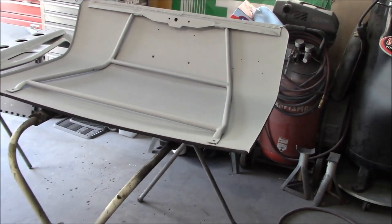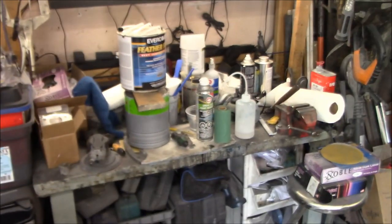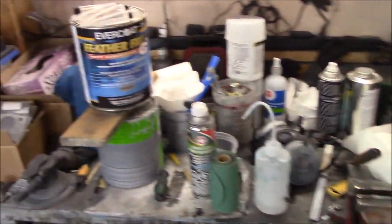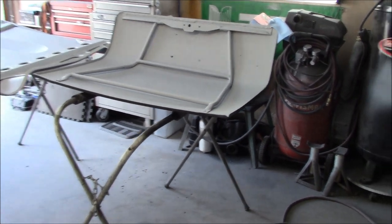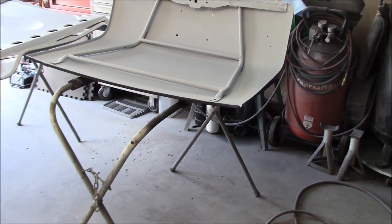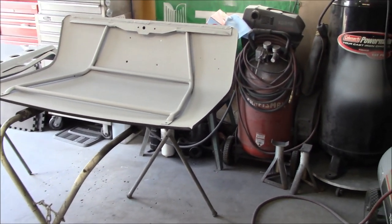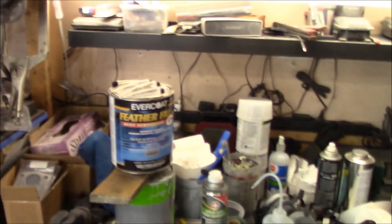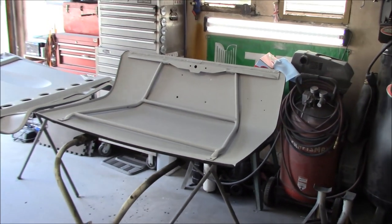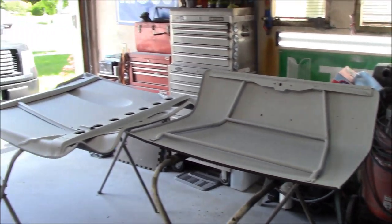So we'll flip those over, and I've looked at the technical data sheet for the G2 primer, and it's telling me that I need to sand my epoxy base coat down to, well, since this epoxy has been sitting for longer than 7 days, the open window has passed. That means I need to scratch this down or abrade it for the polyester primer to stick to it. And it's telling me that I need to sand that down to 320 grit before we proceed to the next step, which will be spraying the actual polyester primer.